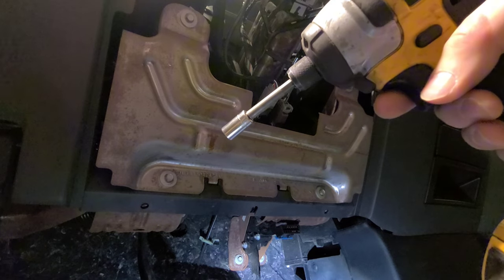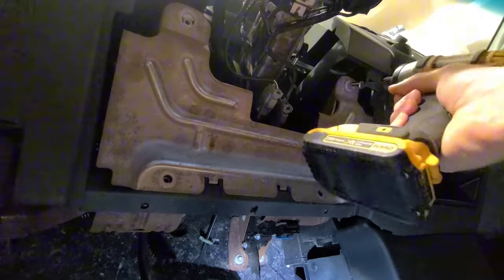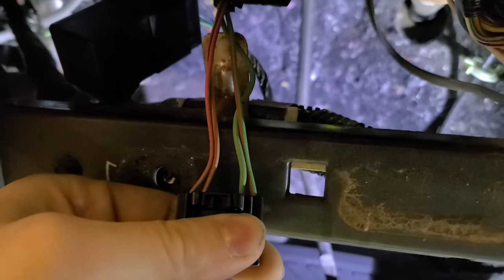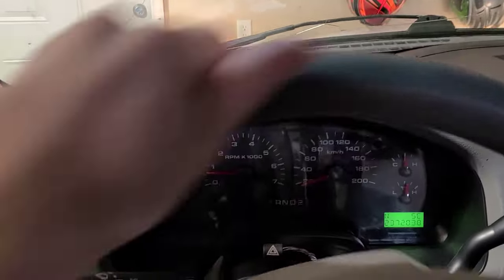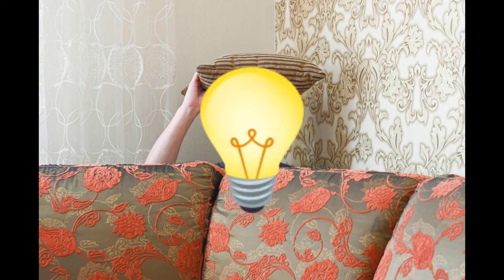Using an 8mm I removed the four kick plate bolts. With the kick panel off I'm looking around the brake switch wiring to see if there are any shorts, kinks, fraying wires, or anything out of the ordinary. Everything seems to be normal. So I decided to follow the definition of insanity, popped a new fuse in, and pressed the brake pedal for good measure.